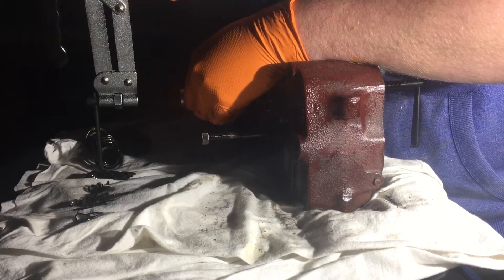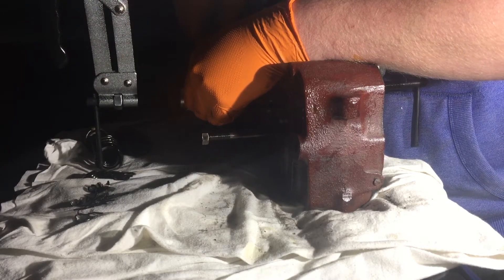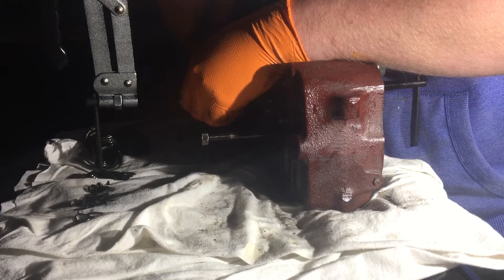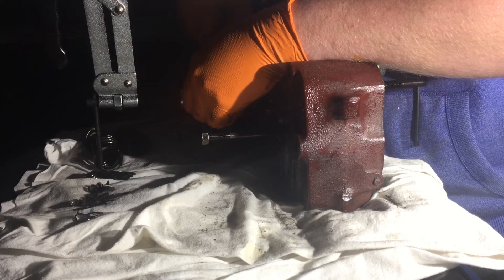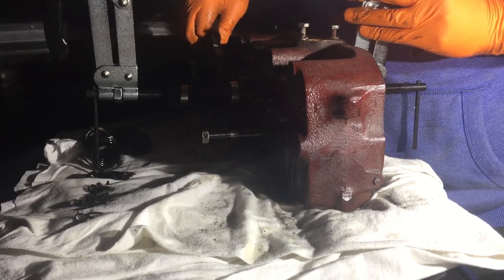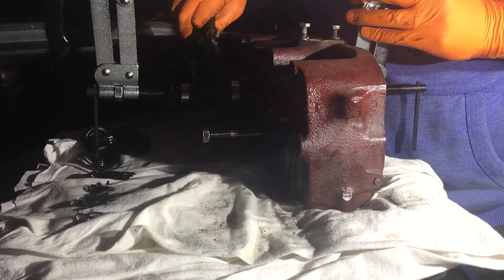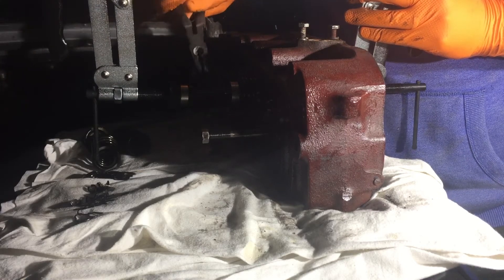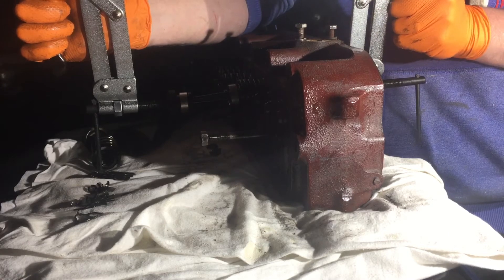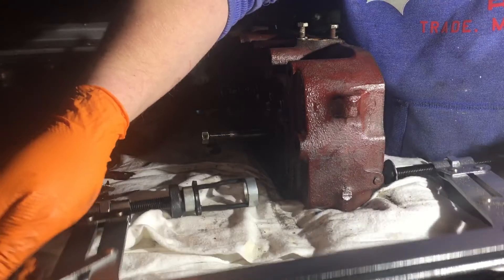What I'm going to do is lift the little collets that retain the valve. These ones are deciding to be a little bit sticky. There's one out, two out. Then what you want to do is release this with a fair degree of control — nice and slowly. There we go. Set that off to the side.